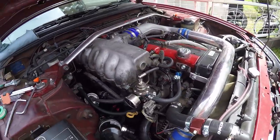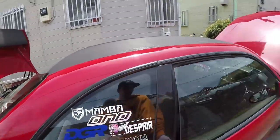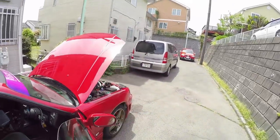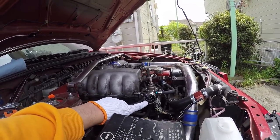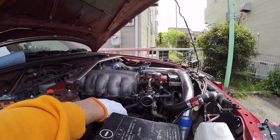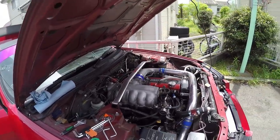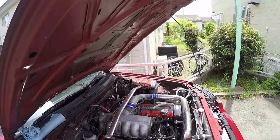The gauge is now installed and looking good in the right orientation. I'm going to prime the fuel pump — the easiest way is to turn the ignition on until you hear the fuel pump come on. You can hear that. If I come over here, we can see the gauge is saying we're at two kilos of pressure. Once the engine starts and the fuel pump's constantly on, that should go up to three.